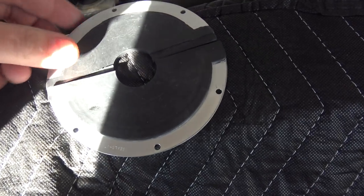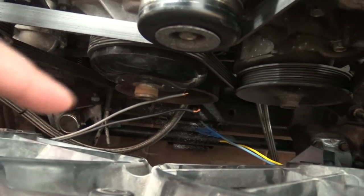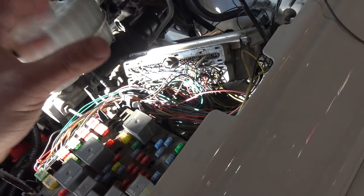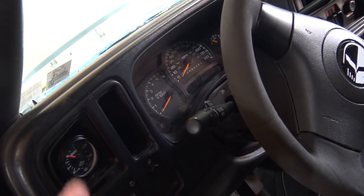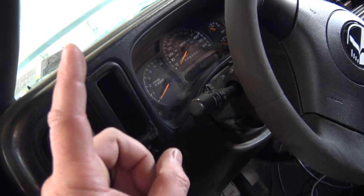War Performance sent these cool parts, and they're also sending an extension harness and a fan harness that plugs into all this, which I'm going to wire for relays. So the stock computer is going to do fans, alternator, air conditioning, run the dash, and all that other stuff. A lot of you guys might not know — this year truck, the fuel level sending unit goes into the ECU, it interpolates a zero to 100 value, and then sends it to the dash over serial data. So the fuel gauge does not work unless you have the sending unit hooked up to the computer and the computer is delivering a Class 2 data feed of percentage filled.